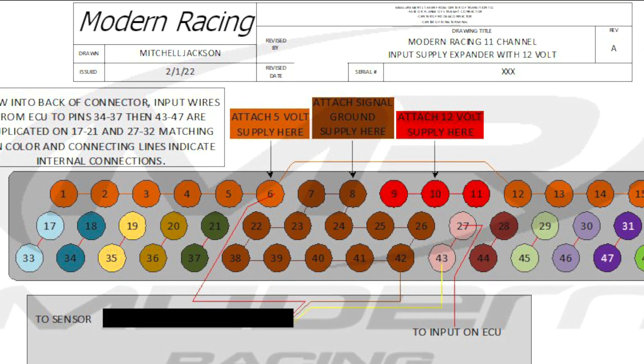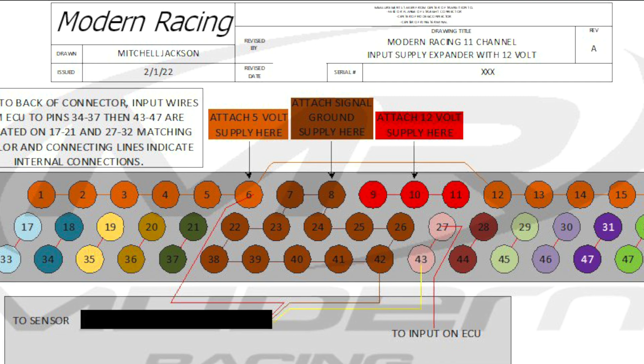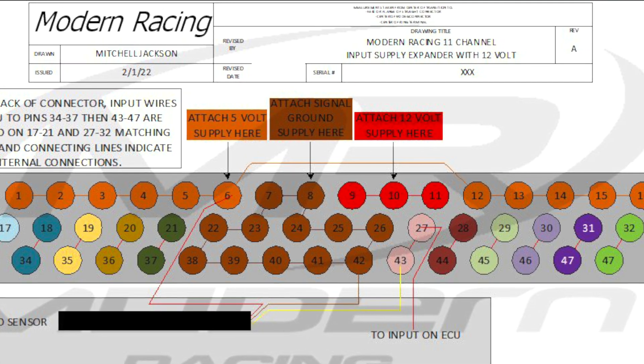When you mount this one, it mounts so the connector is vertical or horizontal with the firewall. So when you plug in the connector, everything lays against the firewall — you don't have anything sticking up. Another big request was that we had flex inputs on it. So you have your zero and your five volt splices built in there, and we also have a flex input that we can use for 12 volt — like for a driveshaft speed or a ride height sensor — with two outputs available for that. We also wanted a connector with a good lock on it, with double-lock pins, and the circuit board itself had redundancy on the traces in case of failure. We were able to cover all that inside that box.